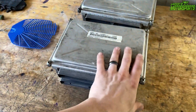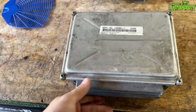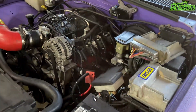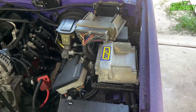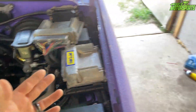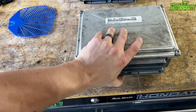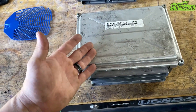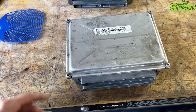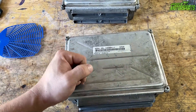Just beware — you could have a bad PCM like I did on this one. You can see I wrote 'Trans Issue ECU' on it. This PCM was causing my transmission to not shift right. We swapped a different one in from the junkyard, put the tune on it, and it's perfect now. The PCM can be bad and still run the engine fine — this would be good for a manual transmission vehicle but not for an automatic since it has transmission issues. The speedometer worked; it was just constantly kicking on and off at the shift points causing serious issues.